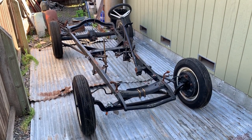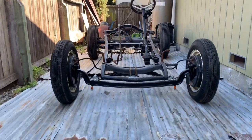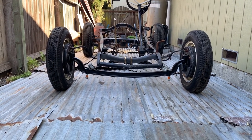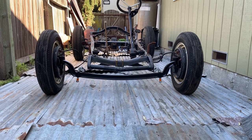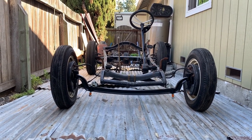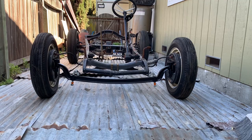So here's what we're working with. I believe this is the 1931 frame. It's got a frame width rear step to lower the back a little bit. It's got a SoCal 4-inch drop axle sitting underneath it right now. I know a lot of people don't like the look of this axle with the tapered ends, but I think it looks pretty sharp. The price of 32 axles has gotten so insane that that wasn't even an option. I've got some — I think they're 46 wishbones that I've split — that I'm going to install, and then it's a reverse eye super glide spring on the front. The front sits nice and low with a decent little rake to it.